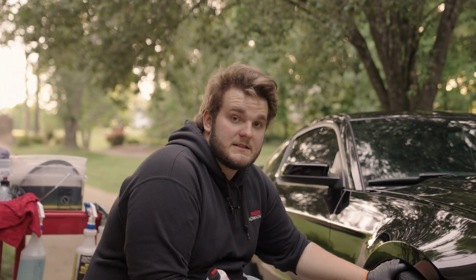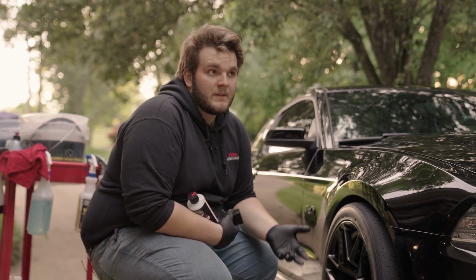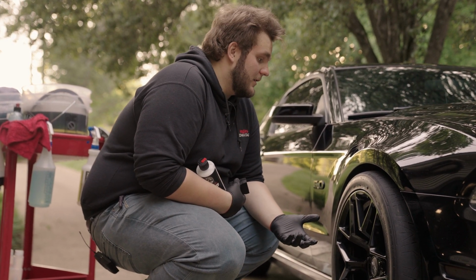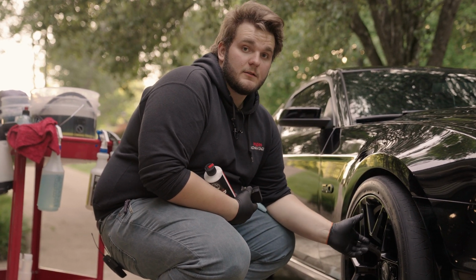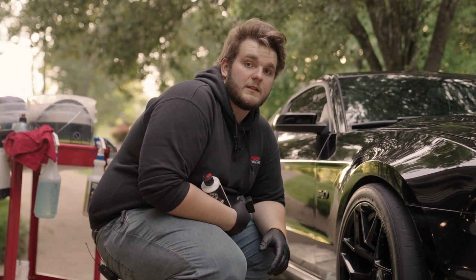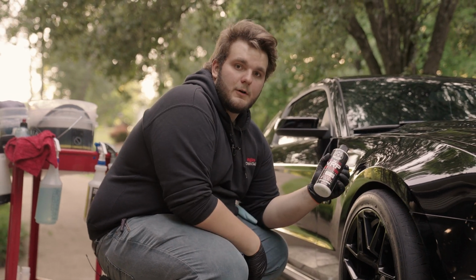And what that creates is, once your tire starts spinning, it creates what's called fling. Now that's great and all, because it's a nice shine, but what happens whenever you overspray with a silicone-based dressing is it gets on the rim, it picks up some brake dust, which is acidic, and it will fling onto your paint, sit there, and etch its way onto the paint. So in order to avoid that, buy a simple water-based dressing.